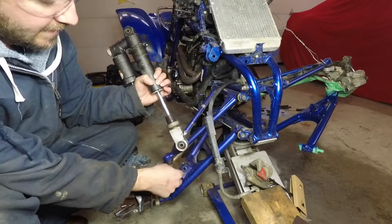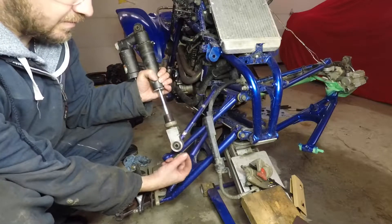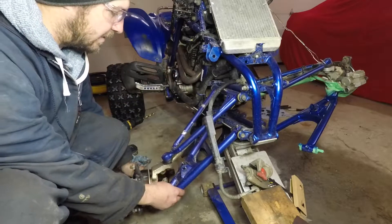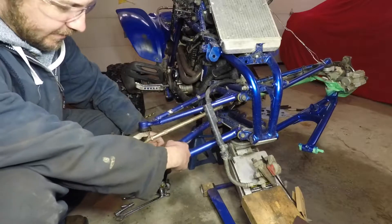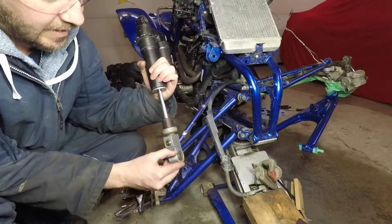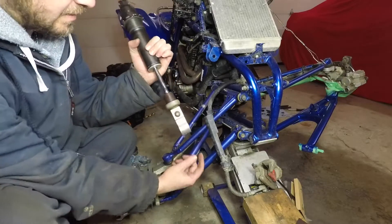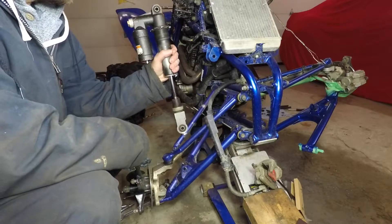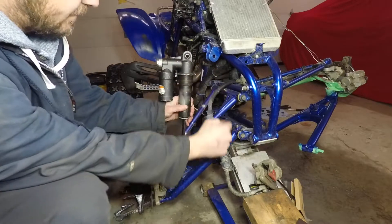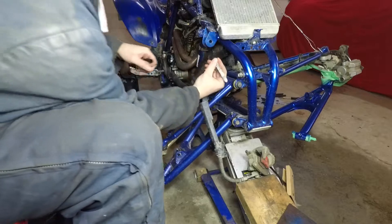So what we've got to do is cut out the plate on the A-arm. Obviously that's preferable to me because these can be replaced a lot easier than this clevis can. The other thing you've got to do is notch out a little bit of this material on the backing plate just so it clears. You can see these shocks - whoever I bought them from must have been running them on something that didn't quite fit either, you can see some markings there. I'll cut that down and make it fit better. I'll show you how to cut this out - right now marking with a pen to give me a guideline.